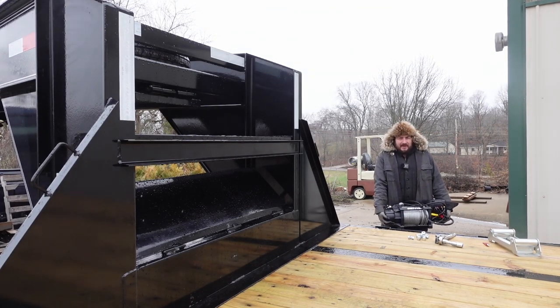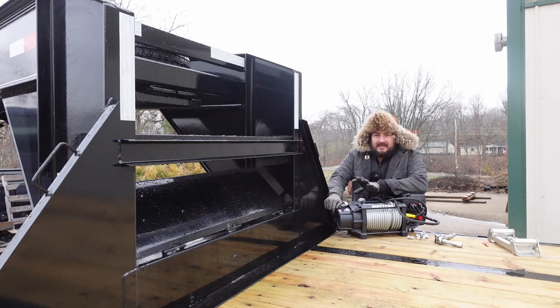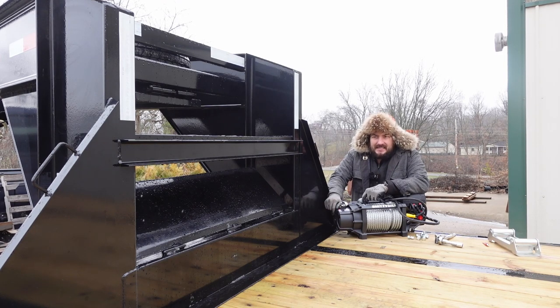This definitely weighs more than a bag of concrete. First thing is to get everything mounted before wiring, so the wires end up the right length. I work from the outside in — get everything bolted down where you want it, then run wires, terminate connections, loom it up, and make it look neat.